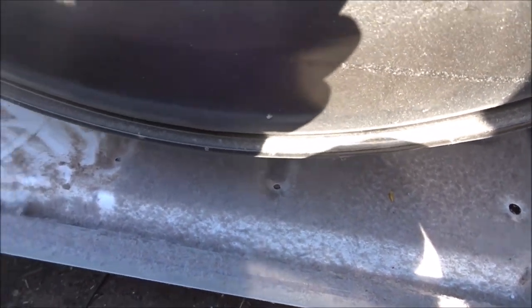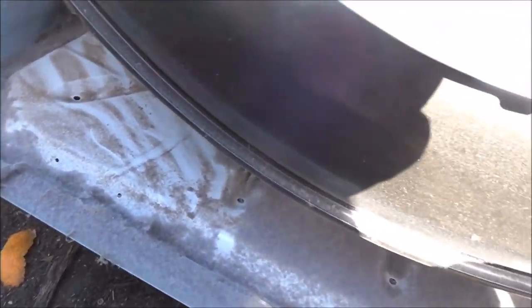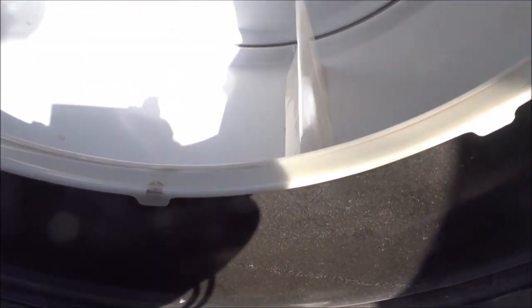Basically there's an overheat fuse that will blow if you don't have good flow on your vent. So why would you take your dryer apart like this? Well, if you have a rattling noise, a funny noise, or your drum — your machine may not even come on if the belt is broken.